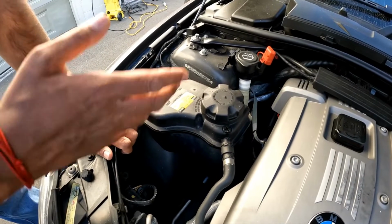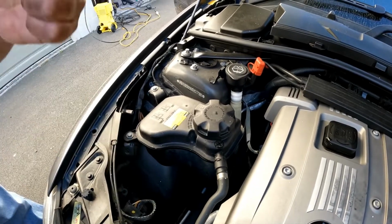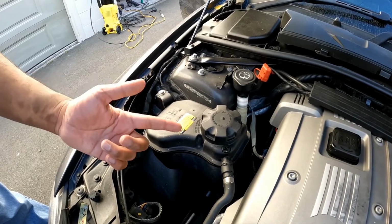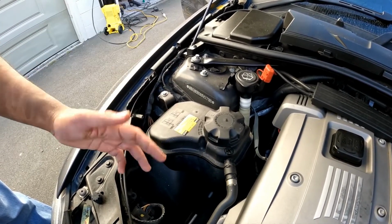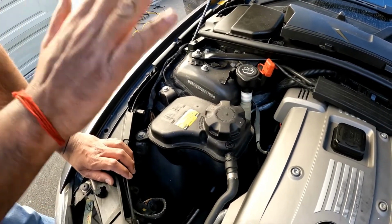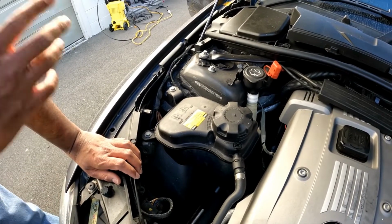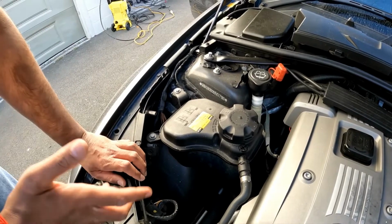Alright guys, after you've gone through the process that I had advised just now, by actually turning the ignition on and then turning the fan speed to 1, the fan speed of the aircon, and then putting the temperature all the way to 28 degrees, or the highest option that you have, and then what you're going to do is you're going to press and hold down the accelerator for approximately 15 seconds. And now this is all while the ignition is turned on. Do not start the engine during this process.